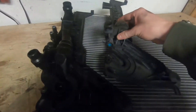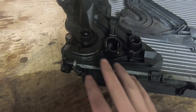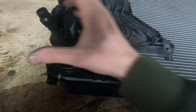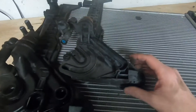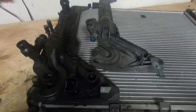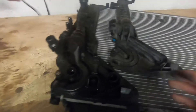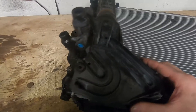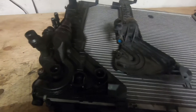So I'm going to set them next to each other so you can see the differences. This one here has the holes where coolant will flow to the extra box for your trans cooler. On the manual, that doesn't exist — it's just plain plastic. So what you have to do is pull this off your automatic, take the manual plate, and it slides in and mounts just the same way because they are the same rad. Then you're almost done.